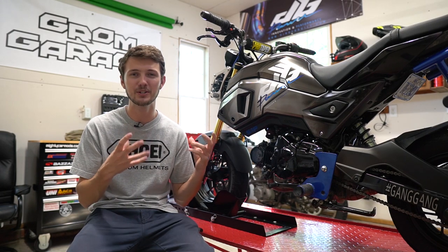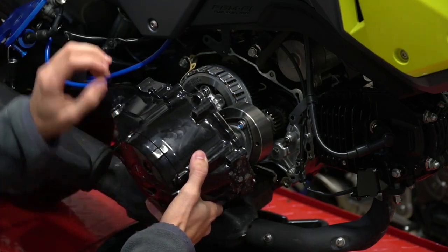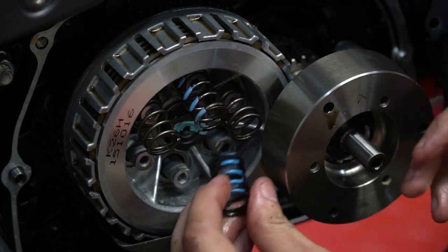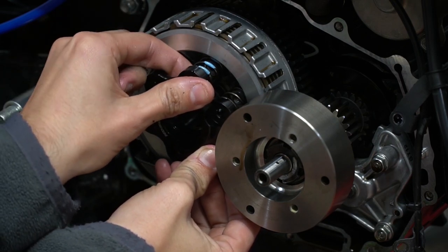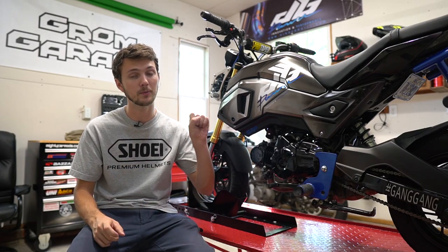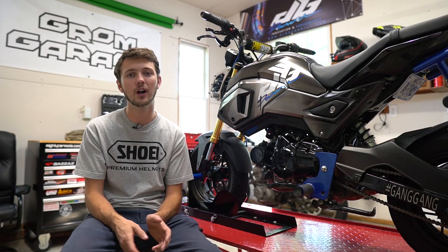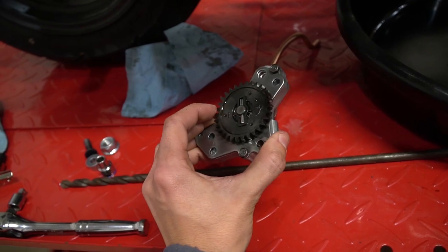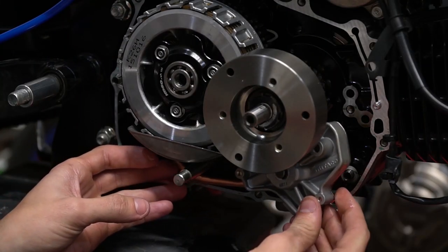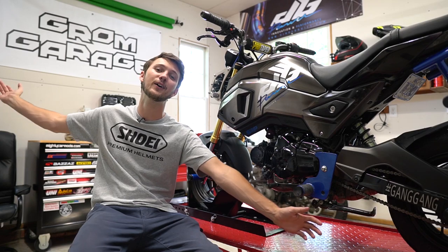Next up we wanted to make the bike pop a little more — and by pop I mean pop for wheelies. So we took off the clutch cover and changed out three of the springs to BUSA springs for a stiffer spring. With a stiffer spring you're going to want to change out the RPM plate to something a little stronger — I'm using the COSO RPM plate so it doesn't crack. With both of those things you're going to get a lot more pop for wheelies. And while I had the clutch cover off I also installed a Straight Up Pumps oil pump to get the oil pickup closer to the back, so when you're in a wheelie it's not going to be oil starved. If you're into stunting, definitely look that up.